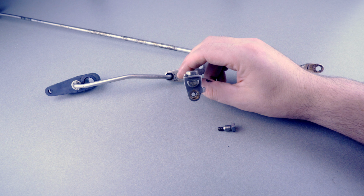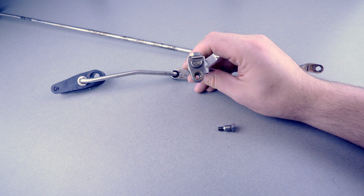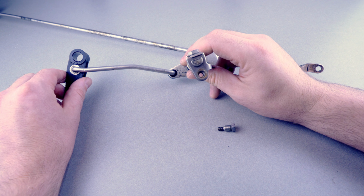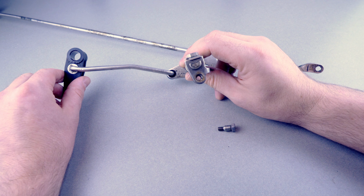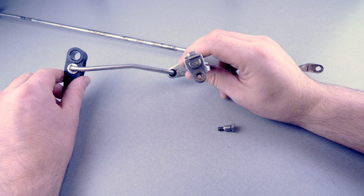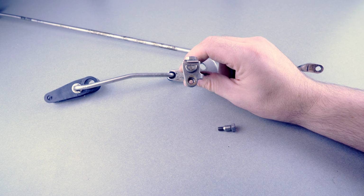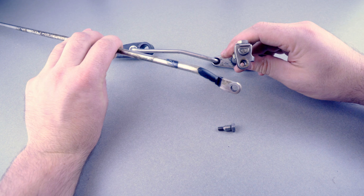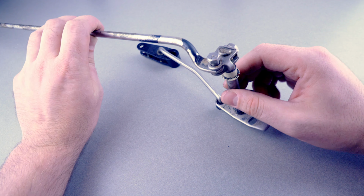Now, as you may know, the shift mechanism changes gears from forward, neutral to reverse. So as you shift your controller, it moves this bar and it will move the linkage a little bit between each gear. So it doesn't move very far, but moves with a decent amount of force. It's kind of like a tough, short motion. And what keeps the shift rod in here? Here I have the shift rod, it goes inside, and the shift screw goes in here and bolts inside.